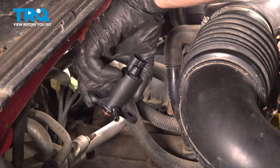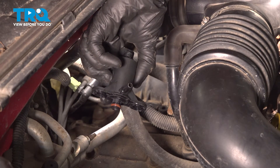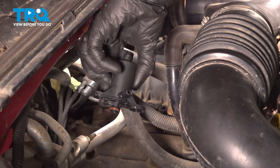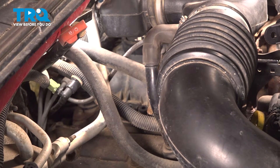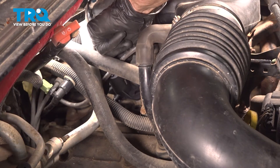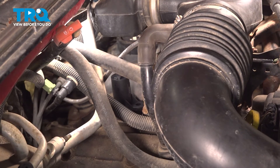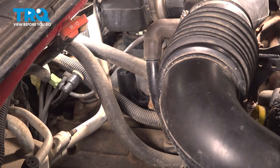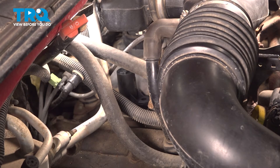Let's prepare for installation of our vapor canister purge solenoid valve. Looking along the bottom of this, where the O-ring is, you'll find that I lubricated it with a thin amount of clean motor oil — that'll help it slide into place. Go ahead and take this and slide it down onto the engine, aligning your two mounting bolt holes. Then you can start in each of those two pieces of mounting hardware. Give it a little wiggle and double check to make sure it's completely seated up against the engine. Start in the mounting hardware by hand and snug it up.